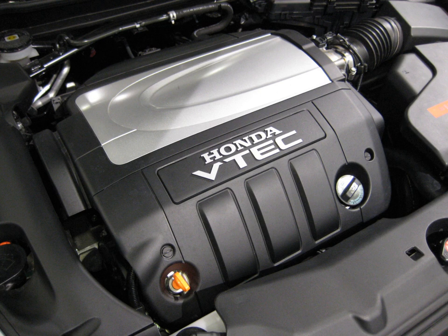J35Y2 (2013–2017 Honda Accord V6 MT manual only): 3.5 L, 211.8 cu in, 3,471 cc. Bore and stroke: 89 mm × 93 mm (3.50 in × 3.66 in). Compression: 10.0:1. Power: 278 hp at 6,200 rpm. Torque: 251 lb-ft at 5,300 rpm. Valvetrain: 24V SOHC VTEC with traditional VTEC cam profiles on intake valves. VTEC engagement: 4,900 rpm.